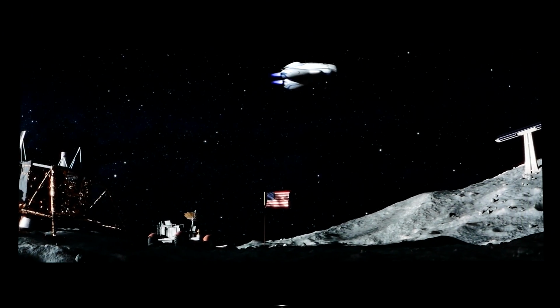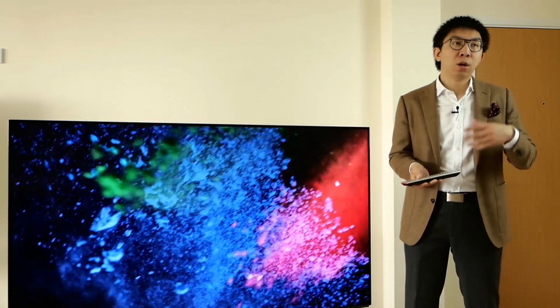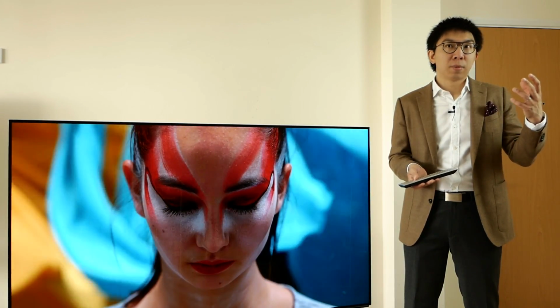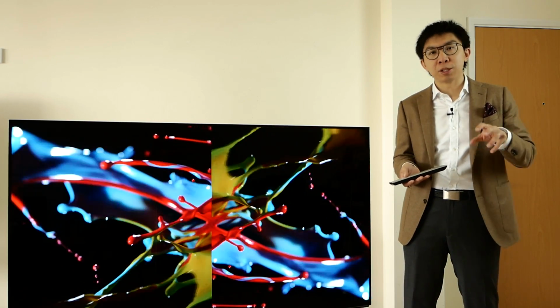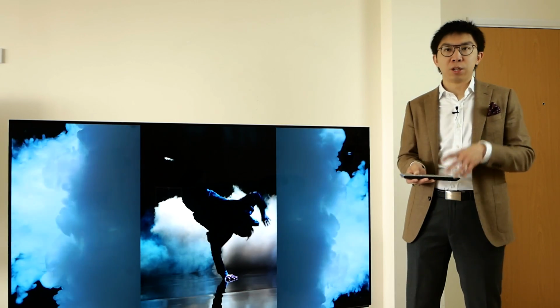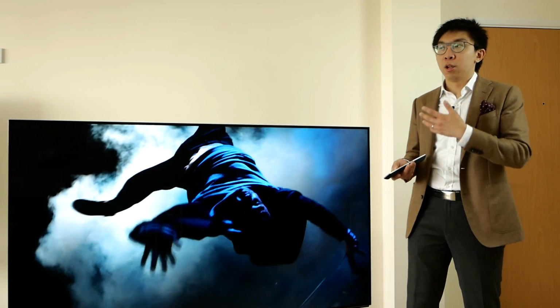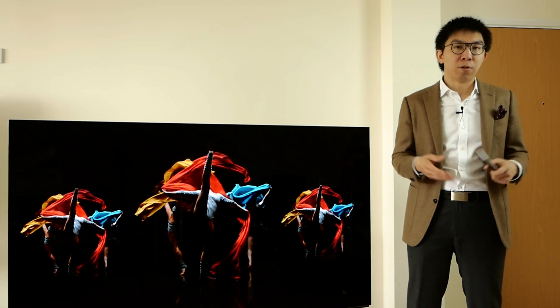opera effect. Even if you decide to go into motion flow custom on the Sony A1 to adjust the smoothness control above minimum, which is off. So smoothness minimum is off on the Sony A1. If you increase it to 1 to activate the interpolation to reduce motion blur, it will still introduce some very slight soap opera effect. Whereas on the Panasonic, you can use the intelligent film creation custom to adjust blur reduction without adjusting film smooth, and you won't get any soap opera effect while increasing the motion resolution.